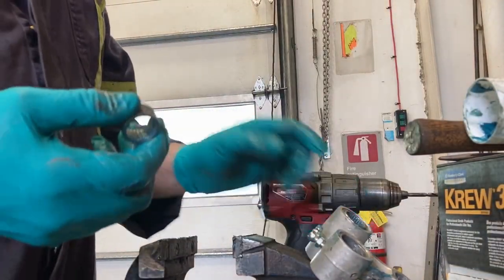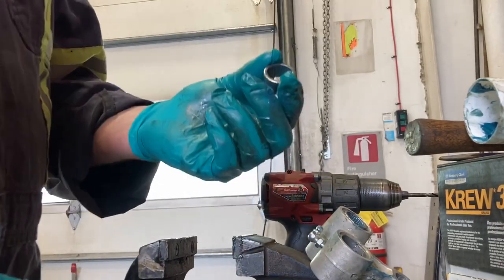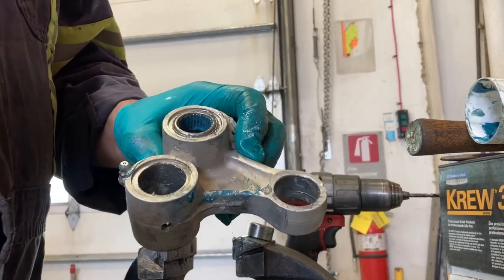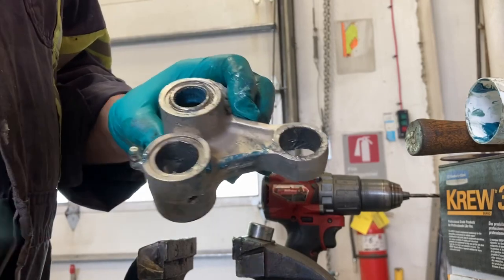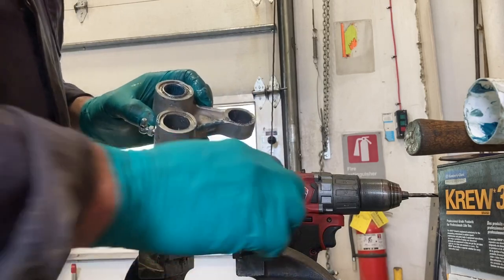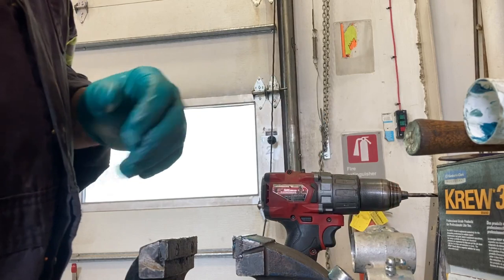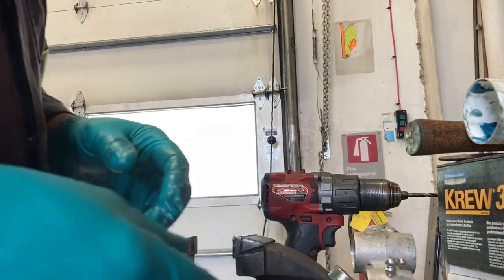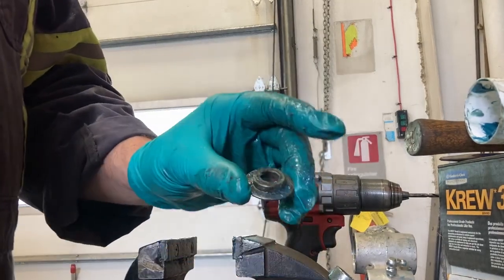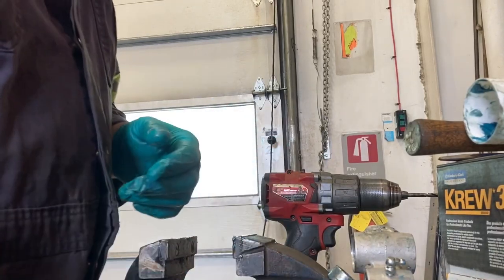So here are the new bearings. I like to smear a bit of fresh, high-quality grease in there — I'm using Metlon again, that's kind of my go-to for that. I also go ahead and put some anti-seize in these; it really seemed to hold last time and the bearings came out really easy. I've got the All Balls kit here, which is really nice. I've heard people say the bearing quality might not be the greatest, but the nice thing is it comes with all your seals and your bushings — you don't have to order it all individually, it comes as a kit.